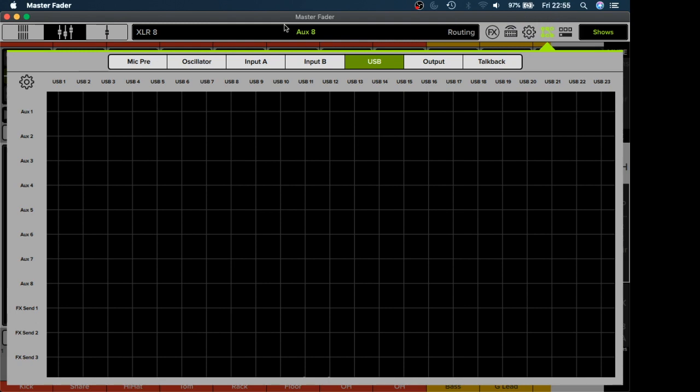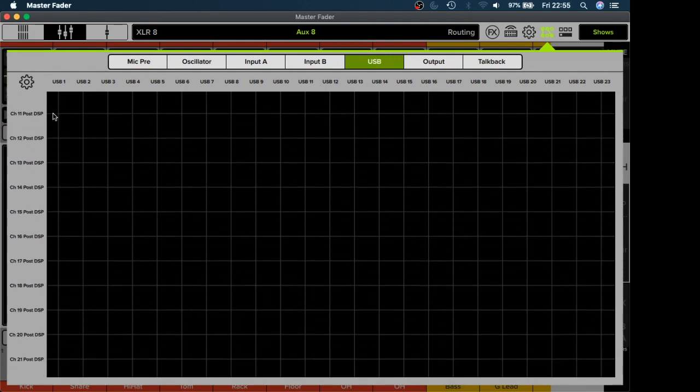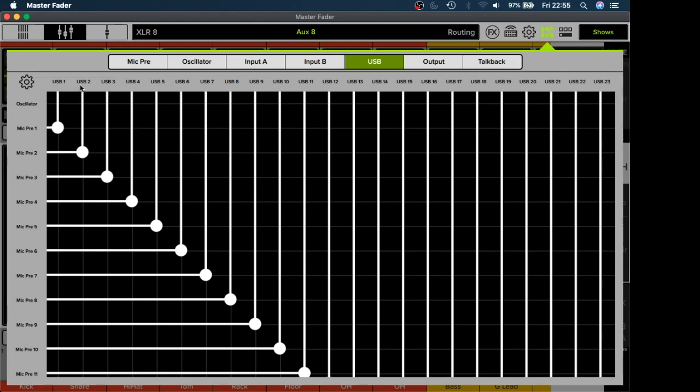It's 10:55 and I've had to work all week. Where you actually do this is here within the USB section of the mixer. The USB 1 and 2 going out through your USB cable is currently taking input from only mic pre 1 and mic pre 2, and that's going straight into USB 1 and 2, then being sent out through your USB port. You'll find this with a lot of other digital mixers as well — you can only hear things plugged into mic preamps 1 and 2.